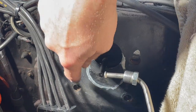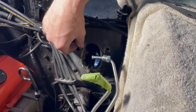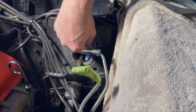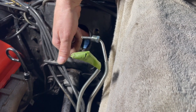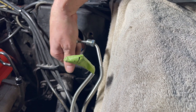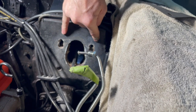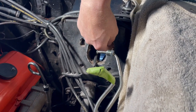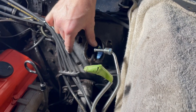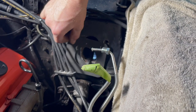The area transferred that you see, we're going to go ahead and cut that out. You can do this a few different ways — if you take your time, you can use a few sharp razor blade knives to cut out the insulation pad. You'll feel a little metal edge from the brake bracket behind it. I cut it as close as I could to that and up around my template, then drilled the two holes up top. I used a step bit and just reamed the hole a little more to give myself some play when getting that booster on.